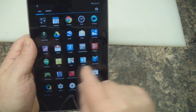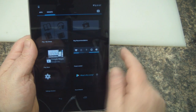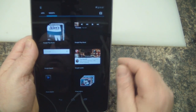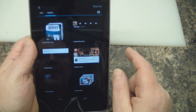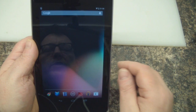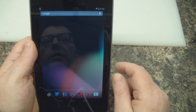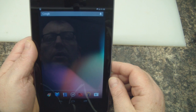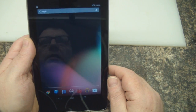The digitizer is working fine and it seems to be just as responsive as an original Nexus 7. It cost me £17 off eBay plus £4.50 shipping for the broken Nexus 7, and unfortunately £35 for a brand new digitizer and LCD from a Chinese seller on eBay — free shipping though. As I said at the beginning, separating the digitizer and LCD when they're glued together is near on impossible. Don't buy the digitizer on its own because getting it off without cracking the screen is a work of art, and the people you see doing it on YouTube normally have expensive equipment. As always, if you enjoyed this, please give it a thumbs up and I'll see you for the next one.